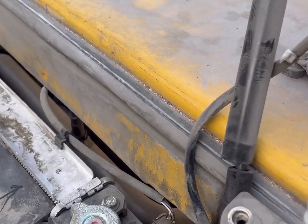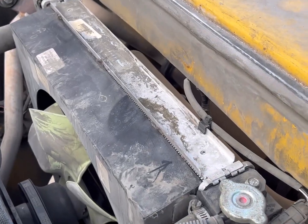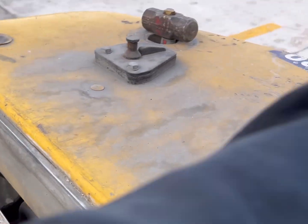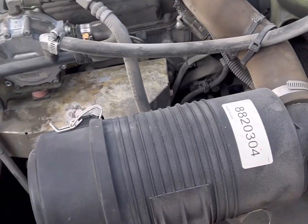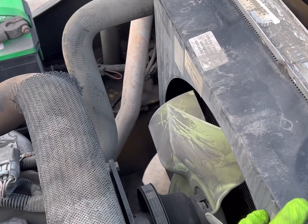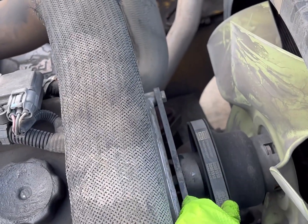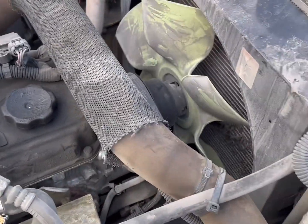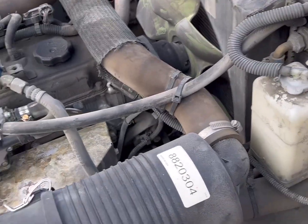There was also a back panel here that goes on top of the radiator that I took off. There's a harness here for the seat switch — seat switch is off as you can see. I'm going to have to take the air cleaner off, the fan shroud, the fan, the serpentine belt, and the fan pulley and bracket. I'll get back to you when I take it all off.